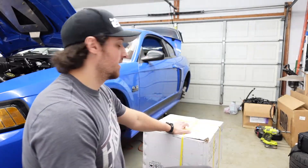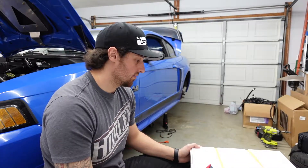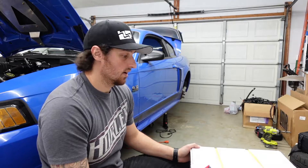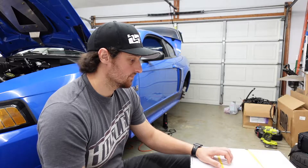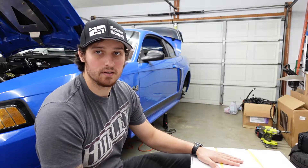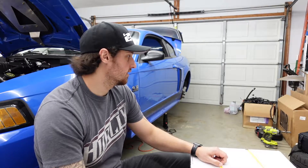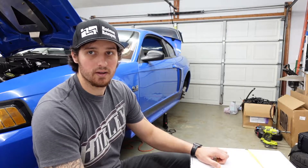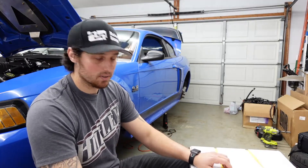Bear with me guys, it's pollen season out here in South Carolina, so I'm sorry if you can't hear or understand me. I got some new wheels in — these are just for the rears. I don't have the front yet but the front tires are coming in soon, which means I need to order some front rims. I'm going with some cheap rears to run on the drag strip, and a whole new set of rims for some radials around the street — since you can't, or really shouldn't, run drag radials on the street all the time. It's also maybe slightly illegal.